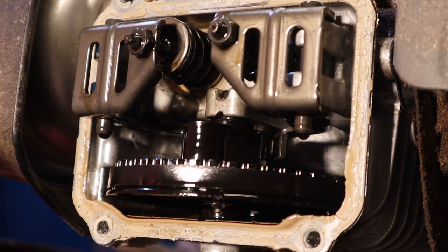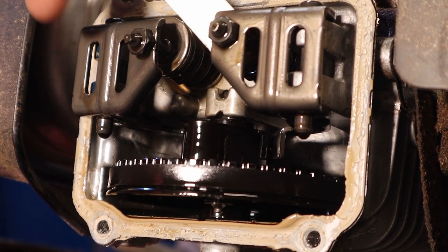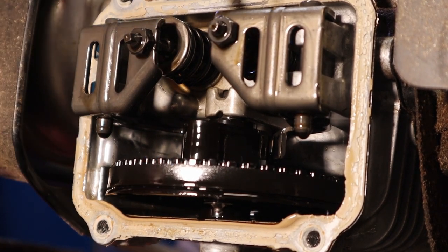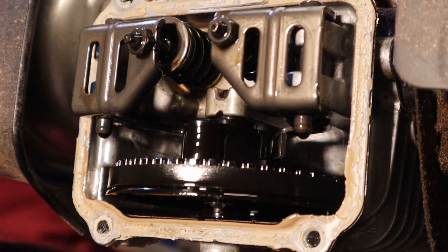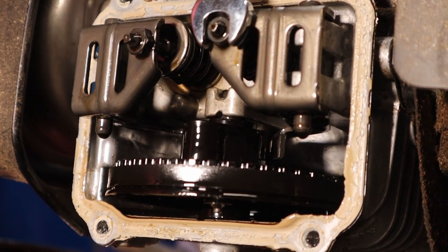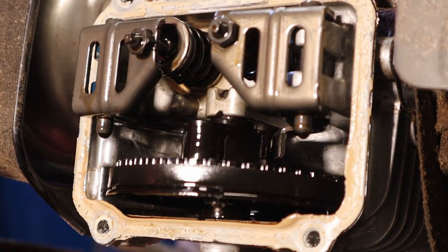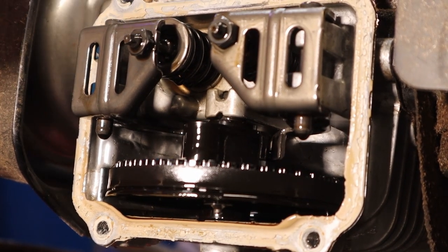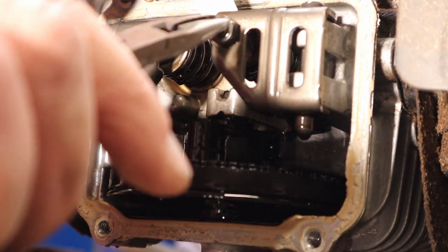Alright, let's adjust our valves. They're incredibly loose. Turns out it's one of those odd things — it's a 9mm, not a 10. I would say it's not too far to assume that these valves have never been adjusted since it was new. That is not too big a leap of faith.